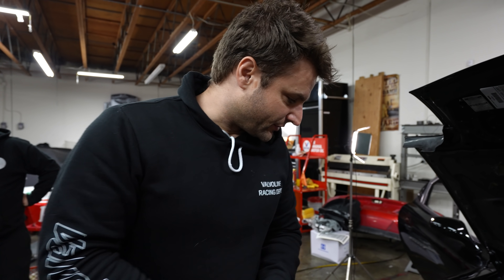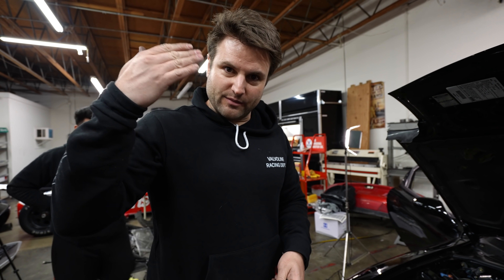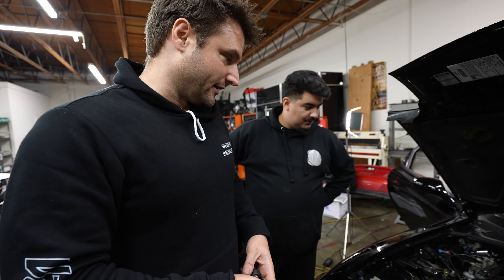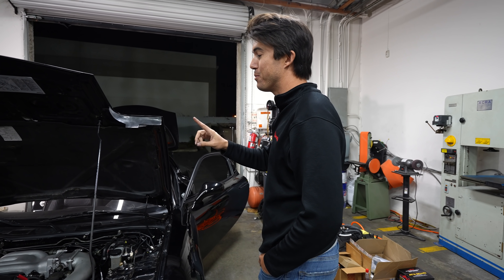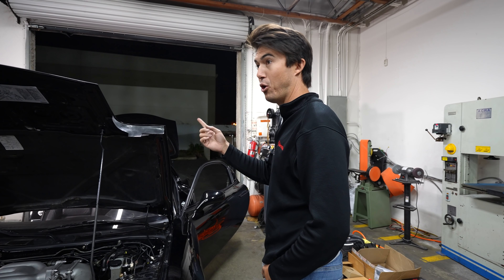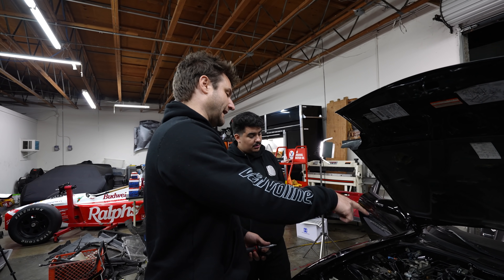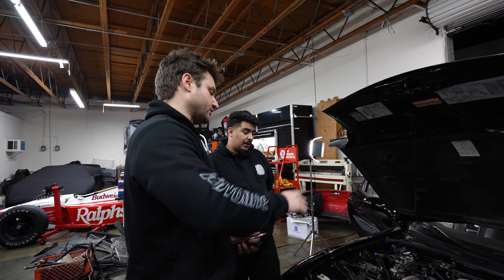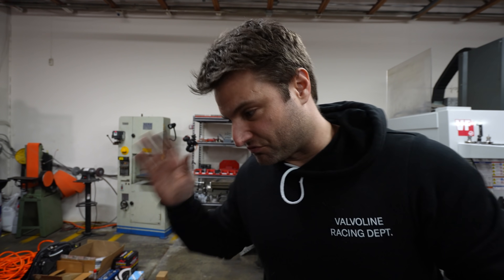It's just a unique noise I'm not used to and I used to run things like this. There are no air leaks — I just did a quick test. He was saying it stays up high and drops down once it warms up, but the car is fully warmed up and that whole system's disconnected so it's not going to drop down. If I could drive it a few miles it will start loping — from around 2000 RPM to almost dying, back and forth — and then smooth out and have a nice idle at 900. There is mechanically something forcing tons of air into it. That's a negative 20 degree mark or 20 degrees ATDC and that's on the trailing plug — they're dead on. So this car is timed properly. Now we can have him go — get out of here.